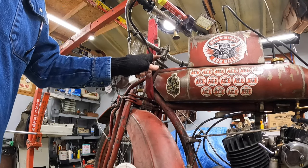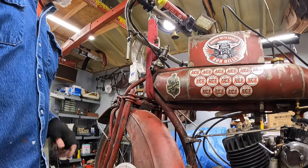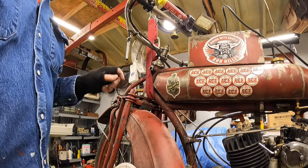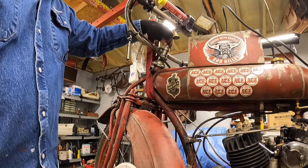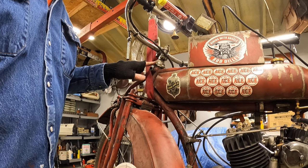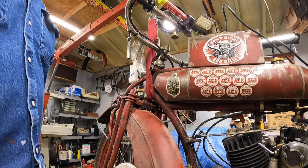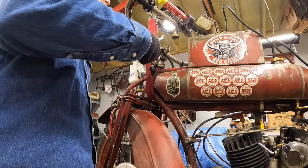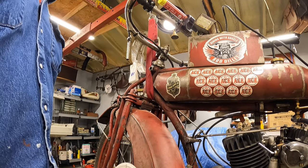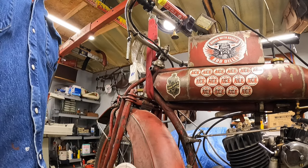This is kind of a stop that, if anything comes loose, keeps things from moving, turning. And this nut down here is kind of a lock for the upper cup. It's a loose ball bearing system, cup and cone. So theoretically, you just loosen this wedge off and it slides out of the post. Sometimes you have to tap on it a little bit, etc. And it'll slide out.